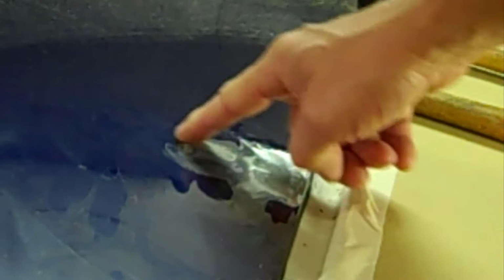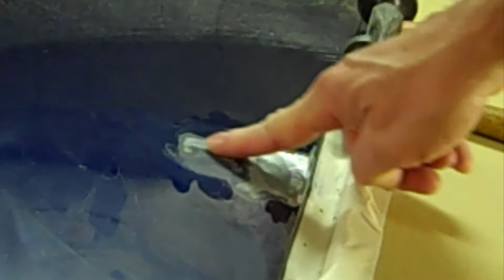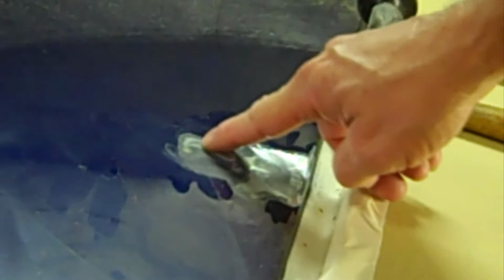But like I said, this whole dent was kind of severe. It was kind of pushed in pretty hard. So you're going to have too much metal when you try to pull it back out. So the studs, they're going on like they did. That's pretty good because when it heats in that one center spot and cools, it kind of shrinks the metal. So here, we're going to have to tap this back down. And it's a little high. I hit it with the wheel just to kind of see how high it was. And it's hard to see the shading, but it's like a darker silver than a brighter silver. And that tells me there's a spot there.